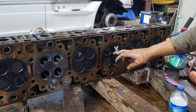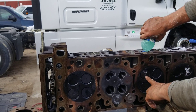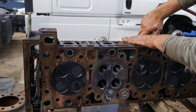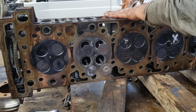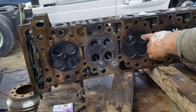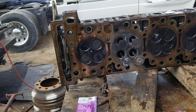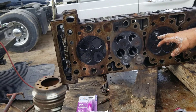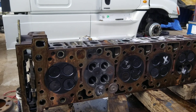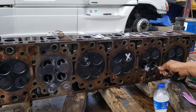Whenever we checked it, it was bubbling up. The water made a seal with rust or whatever. We did just that and it started bubbling up around the ones that were leaking — that's how I knew that the seats and the valves weren't making a good enough seal. A lot of these valves have real heavy deposits from combustion or from EGR.